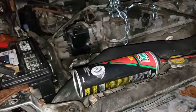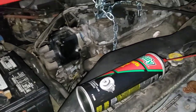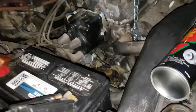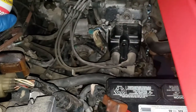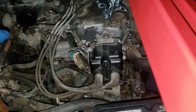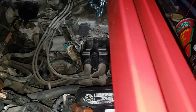We got the trans in the car. Unfortunately I think the fuel pump is not working — I tried three different ECUs and two different main relays, and I'm pretty sure the pump is taking a crap. I know it's not the distributor or ignition system because I can get some starting fluid in there. My lovely assistant's going to fire it up. As you can see it does start up — we probably got transmission fluid spraying everywhere because none of the hoses are hooked up.